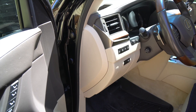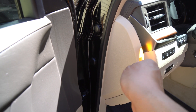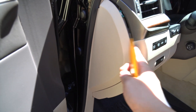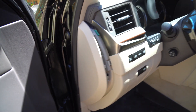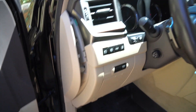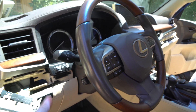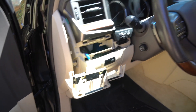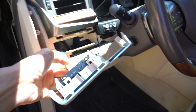Now let's work on the other side. We're going to start off by removing this piece — just place a panel removal tool between this panel. Go ahead and get a little bit of a crack, just like that, and then pop it out. It's popped out. You don't have to remove this all the way if you don't want to. Next we're going to remove this piece — it's all being held by clips. Just hold this and pull it out. You can let it hang or put it aside. I'm going to disconnect the connector here and put it in the back seat.